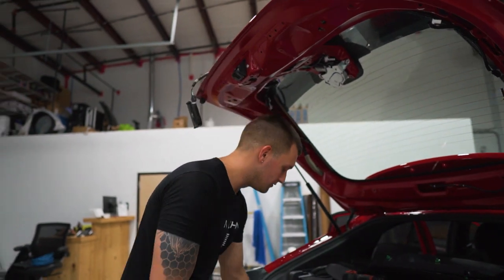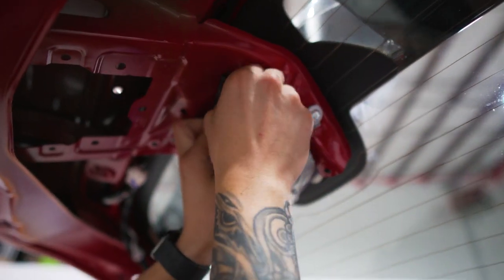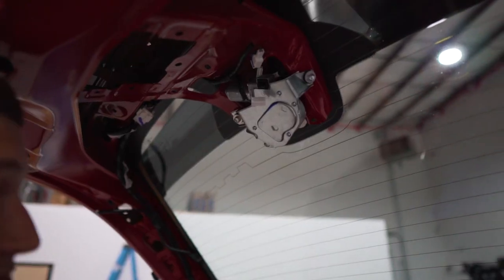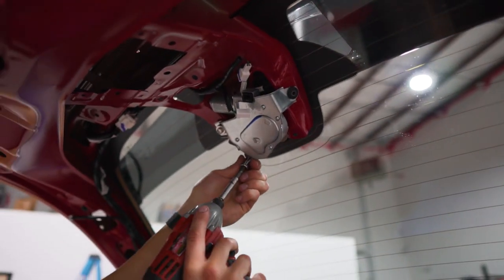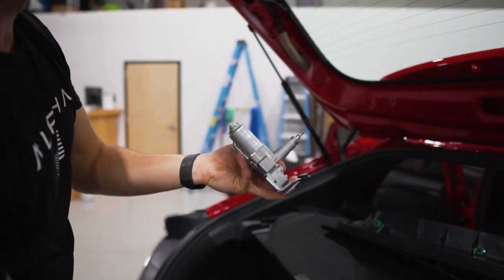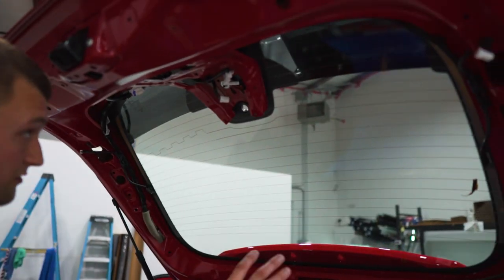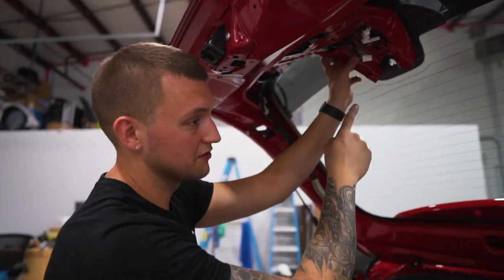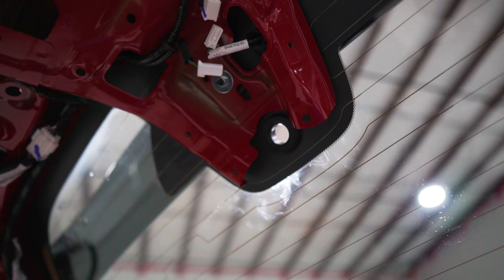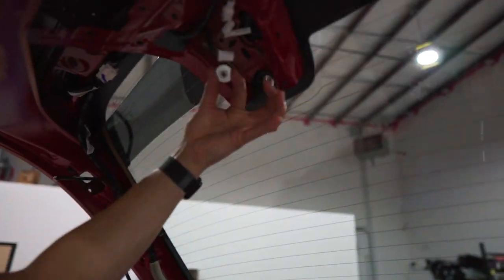Since the wiper is disconnected, pull the motor down and disconnect it. At the same time, disconnect this plug here — that's going to come off with the wing itself. To take the motor off, we've got three 10mm bolts. Hold it on the last one. Pay attention to this little washer — make sure it stays on this side and doesn't go to the other side. The reason we had to take the motor off is because there's another 10mm behind the motor that holds the whole wing on, other than the side bolts.